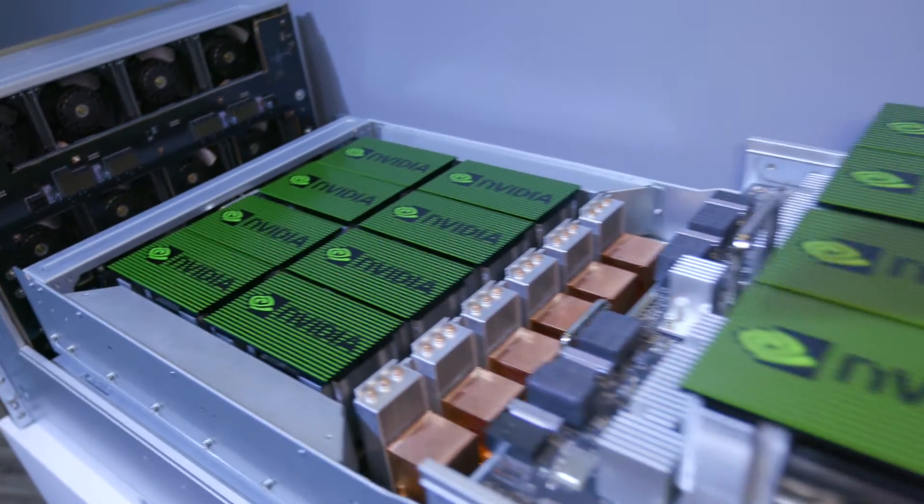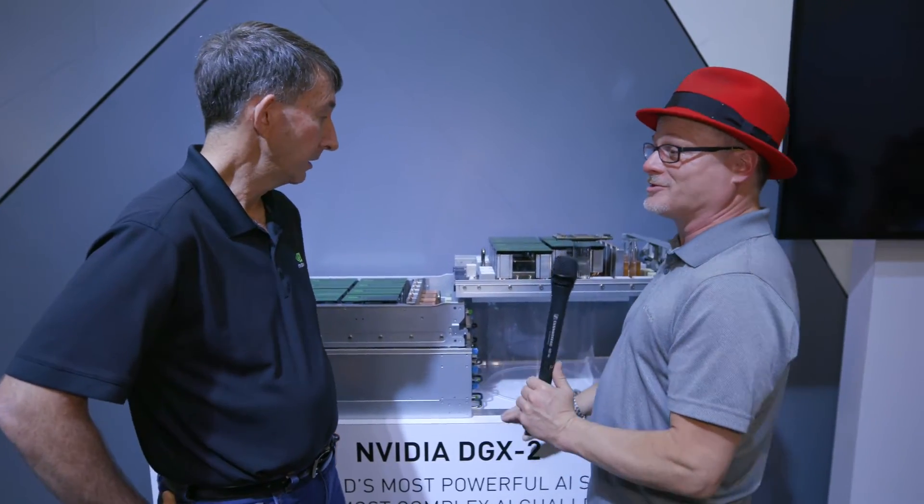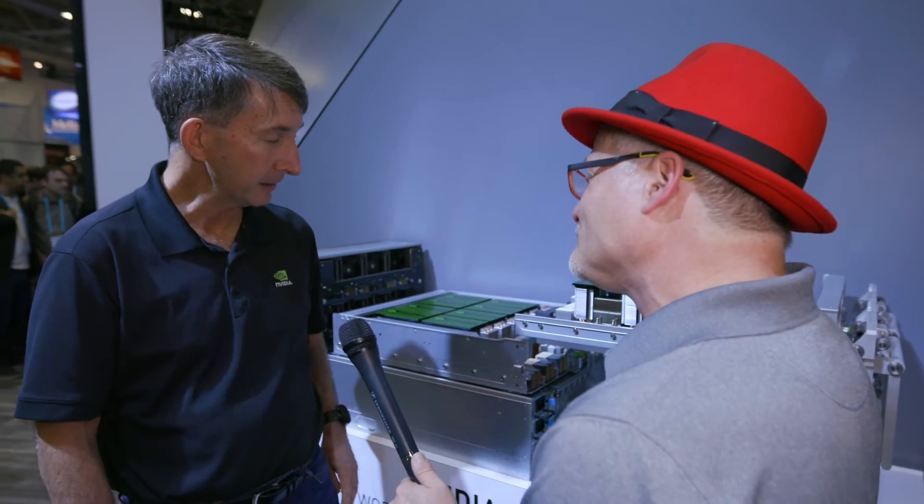So this is a product now, you're saying? It is a product, yeah. When you overclock things, stability becomes a problem — and how do you keep it cool? Those are the two questions. We use air cooling. The fans are all adjustable, so we ran the fans higher when we were running LINPACK. It was very stable — we did a number of LINPACK runs. LINPACK runs for quite some time, so you have to have a stable system; if you have any inconsistency, because it's running in lockstep, you're not going to get good results. That cluster is now part of our larger Saturn V DGX cluster, which is over 1,000 DGXs — ones and now twos — and we use that for all of our internal deep learning, high-performance computing, and other research graphics applications at NVIDIA.